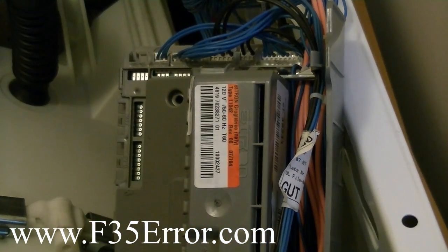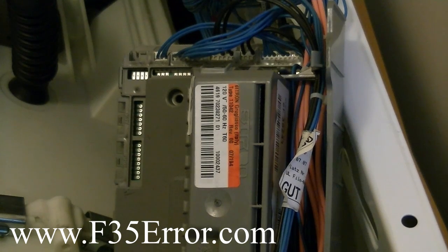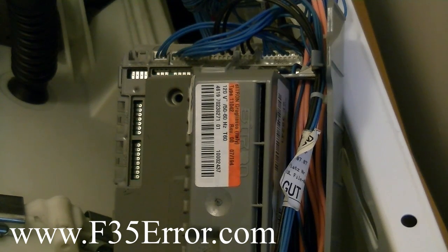As you can see, it's pretty easy to check your pressure sensor. You should get about 0.38 to 0.4 volts with the tub empty. If you get low voltage on that pin 1 to pin 2 measurement, you'll want to look at the pressure sensor itself. Also, you want to check your 5V supply — make sure it's nice. It should be about 5.03 to 5.1.